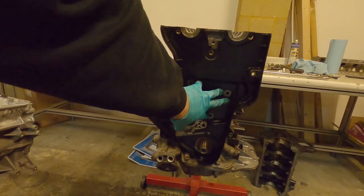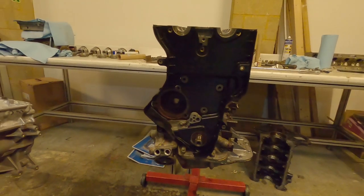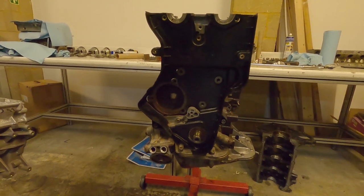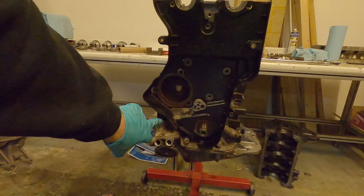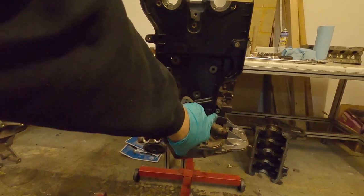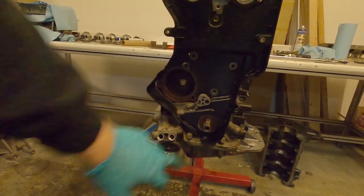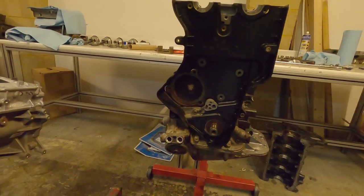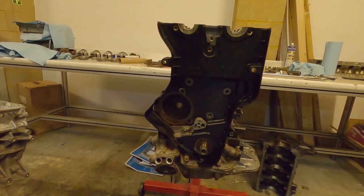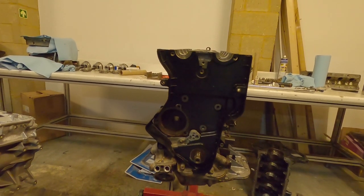This cover goes on first, then you've got the engine mount, the crank pulley, all the timing gear, and the auxiliary belt drive gear. There are also lots of odd little bolts — like these two little bolts here that go through the timing cover into the oil pump and the block. They have a weird little torx bit with a thread in the middle so another bolt goes on top to hold the outside cover — they are different and they don't go in interchangeably. There are lots of oddities when putting an engine together where one specific bolt goes to one specific place, so pay attention to these things. Try to get a workshop manual, and if not, pay close attention when taking your engine apart to where everything went.